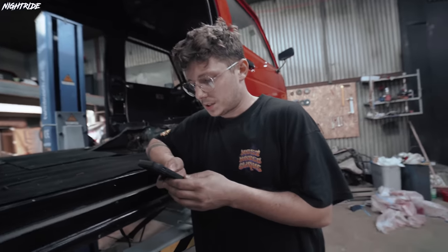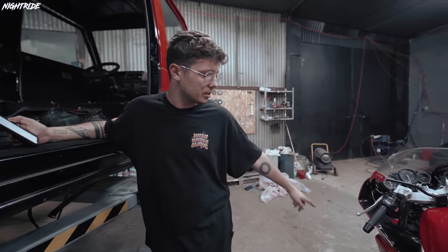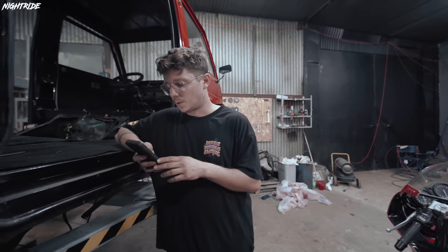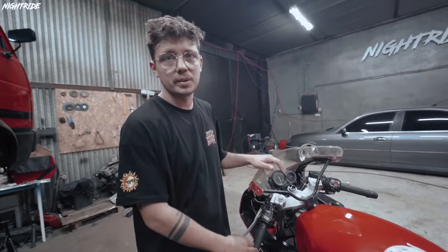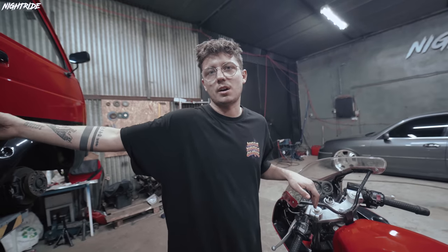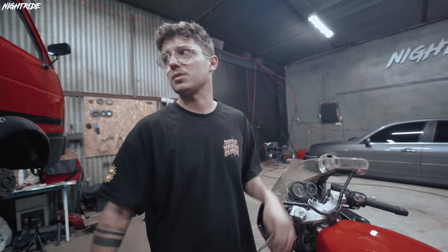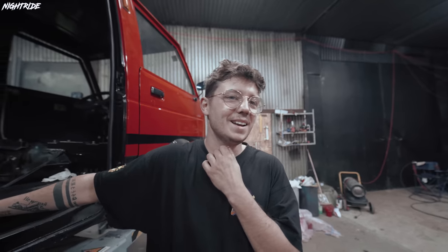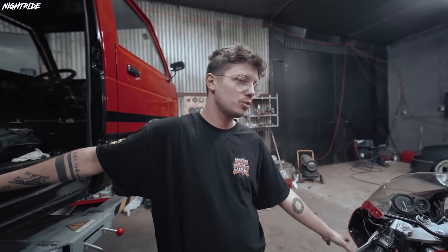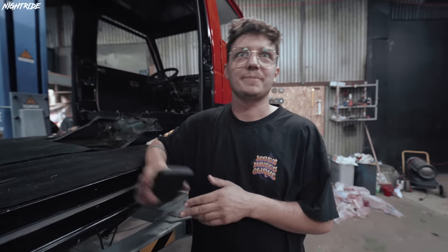Another thing on my list is changing gear. The gear we talked about before is gonna be an easy lever going to the front of the car, that shouldn't be complicated at all. Throttle and clutch both work with just lines, so we're gonna simply connect the lines from the original car's pedals to the clutch and to the throttle as well. I think that shouldn't be the biggest issue. I mean, we say it now and then it's gonna be three videos later. Yeah, we don't know what to do. It would be a much bigger issue if the clutch were hydraulic.